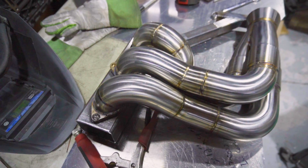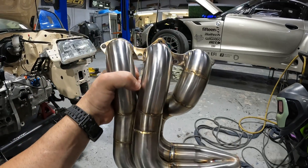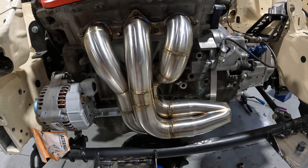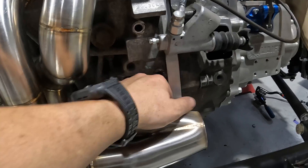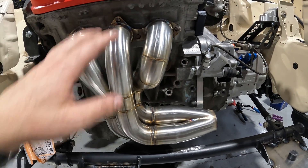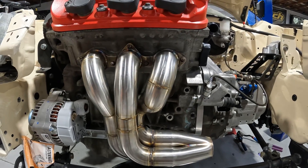Header's pretty much done. It is 2 o'clock — we started at like 10:30 welding this thing up and I'm pretty happy how it came out. It's kind of like your old school V8 header from a hot rod, but it just turned out that way. Let's see how she fits. Oh yeah, look at that — that's going to be perfect. There's plenty of room on the alternator, we went ahead and moved this over for the radiator fan, and we've got plenty of clearance on the transmission. The idea is to come up here and then go into one of the turbos. The back header is not going to go like this — it's going to be a completely different orientation. So we'll bolt this up, get the radiator on, put the front piece on, make sure all the clearance fits.